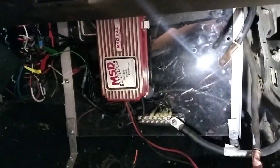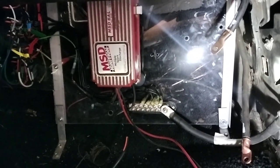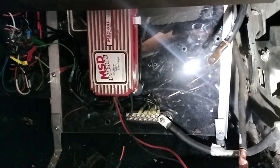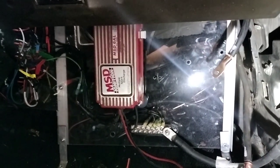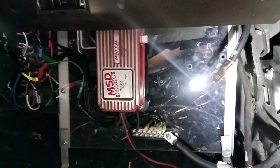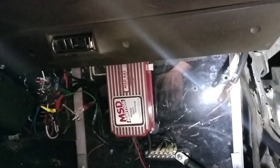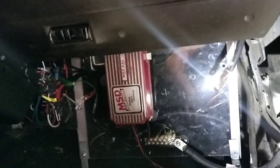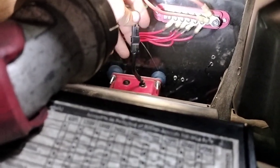The box worked over the winter, but I think I may have actually smoked it welding. It still worked, just up at higher RPM once it started to saturate it started to break up. I didn't disconnect the coil, and the coil will still hold energy, so it could have backfed the box — after doing a little research and talking with people. The box I took out was tested and it was faulty. I have to pick up some orange and purple lead.